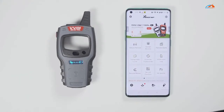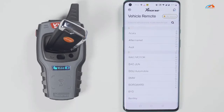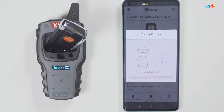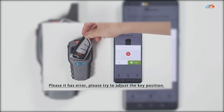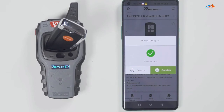Now start to generate a wireless remote. This is the wireless remote. Put it into the keyhole of the Minikey Tool. Then select the car model you want to generate. I have a smart car, so I will generate a smart remote. If it prompts a fail to generate, please change the position of the wireless smart remote because the coil position may not be able to sense the chip. Generation succeeded.